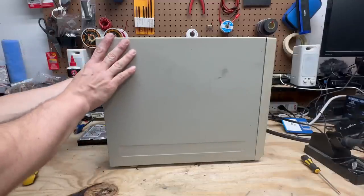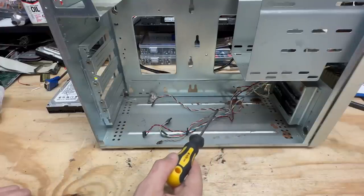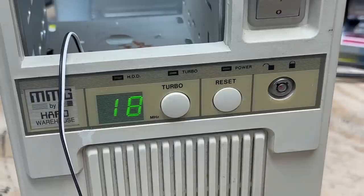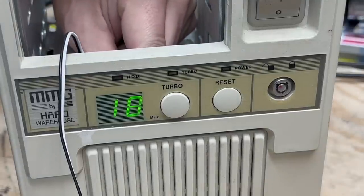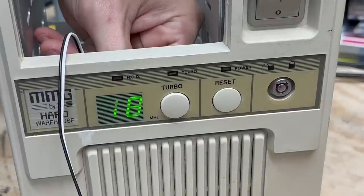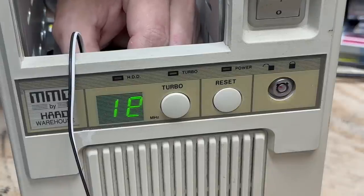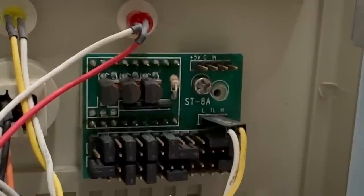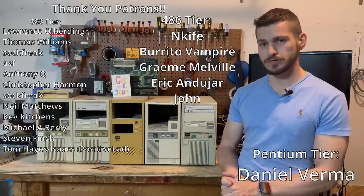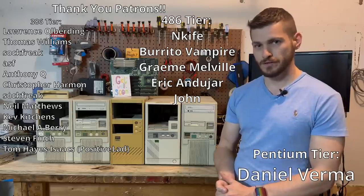Opening it up — apart from a dust bunny and some surface rust, it's actually pretty clean in here. Let's test that little display — and it works. Now I've got plenty of access; I can show you how we change the digits. All we need to do is adjust the jumpers on the back — the jumpers just turn on and off the different segments. These cases used to come with a little booklet showing which jumper configurations led to which digits; without that booklet it's all trial and error. With this case being empty, you can get a better look at the jumper block on the back. I just want to give a huge thanks to everyone who's subscribed, and an especially huge thanks to everyone who's pledged support on Patreon. If you're new to the channel and you like this kind of content, be sure to subscribe. That's all for this video — thanks for watching!